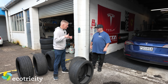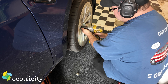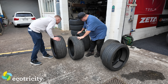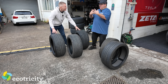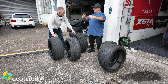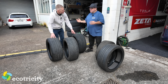First question: can you use any old tire, or should you buy specific EV tires for your EV? EV tires do have lower rolling resistance so you'll go further. As long as you get the right weight rating for your car, you don't have to have an EV tire — but they are better for economy. An EV tire has a stiffer sidewall. If you push on the sidewall of an EV tire versus a non-EV tire, you'll notice it's much firmer.